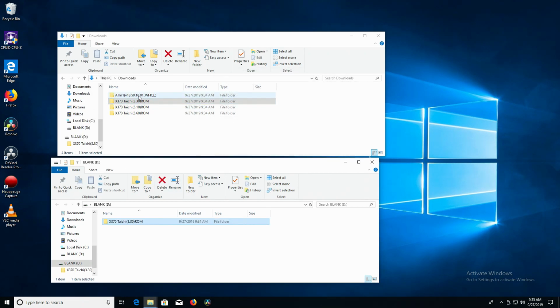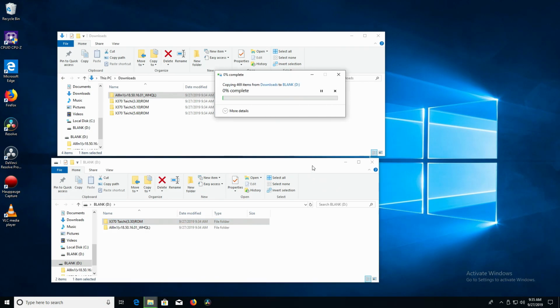Didn't take long. And let's put the all-in-one driver on that too, so that after we install Windows, we can update that VGA driver. Now, you'll notice that I'm going to use 3 different flash drives. The reason for that is I found that it's best to have just one file on the flash drive, and that's it. Nothing more on the flash drive to confuse you, or at least not another BIOS file on the flash drive. And I can already see I made a little bit of a mistake. It's recoverable, but we'll wait till this downloads and I'll explain what the mistake was that I made.